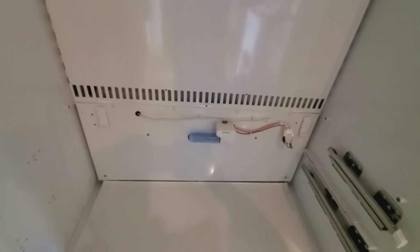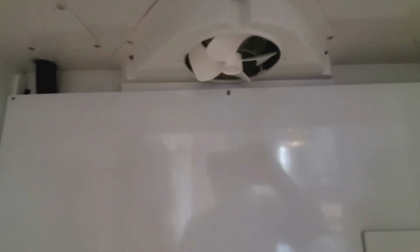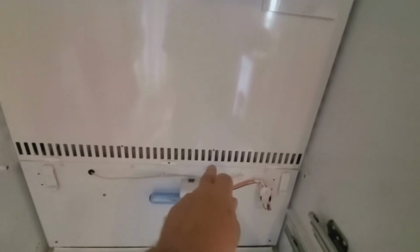So it really doesn't matter what order you do this in. You could put this back wall, the upper duct that it doesn't mention in the instructions, the reinstallation of it is not mentioned. You can put this in before you put this bottom one in, or after. It just tucks right in place, and you put your plastic pop rivets in place, and then what you'll do from there is put your screws back in. Remember, the short screw goes in the center, and then you got the longer screws that go into the standoffs up at the top, and down there's 2 at the bottom.